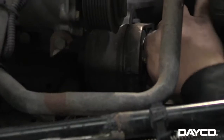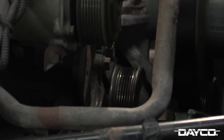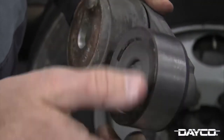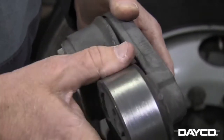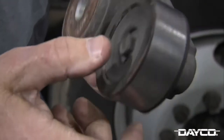Now let's remove both tensioners. Remove the fan tensioner by using a 19-millimeter socket. You can remove the AC tensioner by also using a 19-millimeter socket. With the tensioners removed, inspect the parts for any sign of wear. Be on the lookout for any bearing noise as well as metal-to-metal contact between the arm and the spring case, which is a sign of bushing or pivot bushing wear. Lastly, if there are any cracks in the tensioners or if the tensioner arms or spring case is broken, make sure you replace the tensioner.